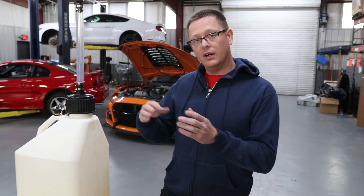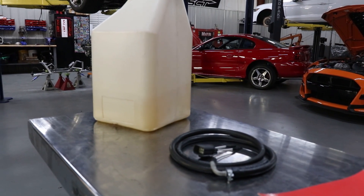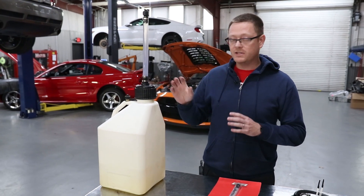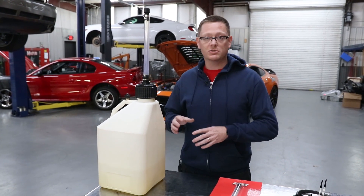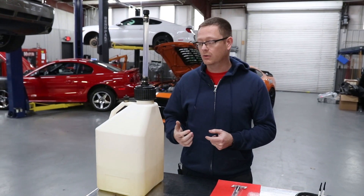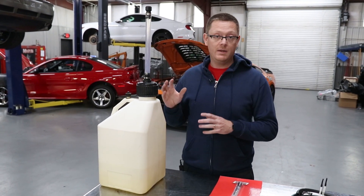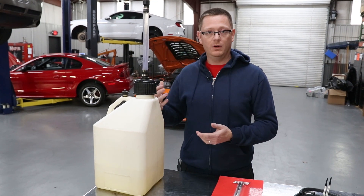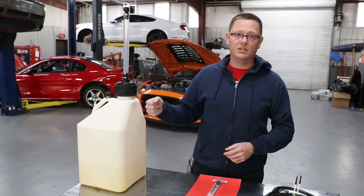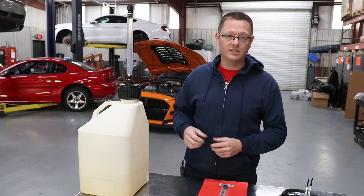We're also including a fuel jug for you guys that don't live near a pump and have to go get the fuel. You can keep five gallons of it stored. It's very important that E85 be stored in a sealed container, so we're including one that seals nice and tight and doesn't let any moisture into the fuel. E85 will actually store for a reasonable amount of time if you keep it in a sealed container and away from sunlight, which can affect it and help leach moisture in. Keep it sealed, keep it in the garage, and you can just put it in the car as needed.